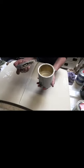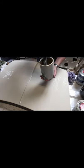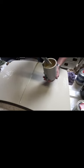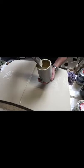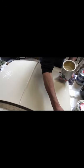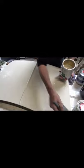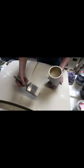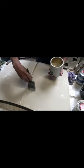Now I've dipped the brush in turps and wiped it, just to give it a sort of primer. Then you just dip it in — that much, that's all, you don't get it wet through. Start in the corner and just apply it quickly, nice and quick. I'm going to do one half of the bonnet to start with; I'm not going to go right across because that would be too much.